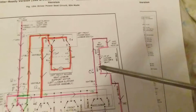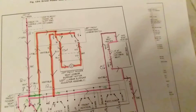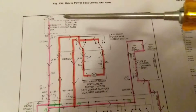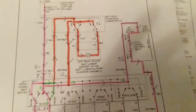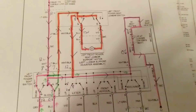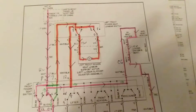There are no relays here — no integration relay module, which is very popular with Toyotas and goes bad pretty commonly. There's no need for relays. The ground is over here and the power comes over here, so there's no reason to have a control circuit for a relay. The fewer parts you manufacture, the cheaper it is. That's why the chip replaced all the resistors and transistors — everything wants to be compact.